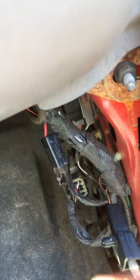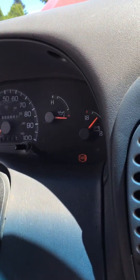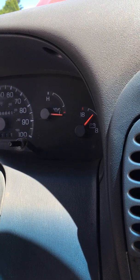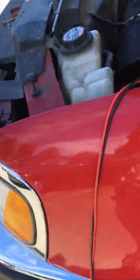So with the key on, briefly touch that orange wire — black wire orange stripe — to ground. That should do it. Read out codes on the light. Okay, eight flashes, short flashes, followed by one long flash. Normally with that code, you just go ahead and replace the rear ABS sensor.